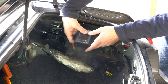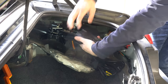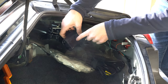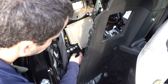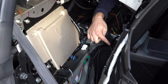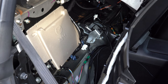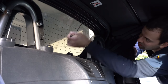Tucked back in here I had the Redenso RCM rear antenna, up just above the rear tail light. Something I found that I didn't realize: the tape that was being used to hold it up had let go and the antenna had just fallen to the ground. That would explain why my rear antenna, arrows, and RCM weren't working that well. So for rear antennas, don't do this. All the rear cables run back on the left side of the car, so I'll head inside and start pulling from the inside. Next I'm pulling the Redenso RCM CPU which is tucked back there. Some of the cables from the RCM run up front to hook up to the ALP, while others run to the back like the rear antenna — so I can start pulling those along with the orange pull cord. Then I'll get the rear dash cam cable out, and finally remove the blend mount and the different dash cam mounts.